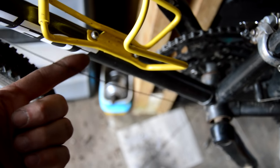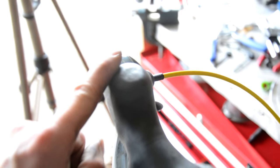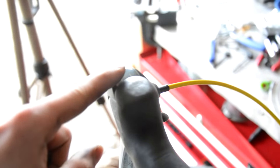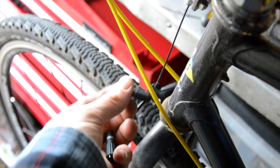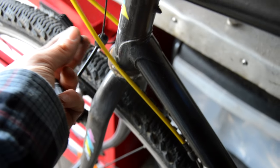Everything's already — the cables are already released. So I'm just going to strip these cables out. The gears are in the correct gears that I need to be. You want to adjust it — big ring up front, little ring at back so it's high-high. But I'm just going to put them in line, sort of around here, so I can adjust them if I need to.